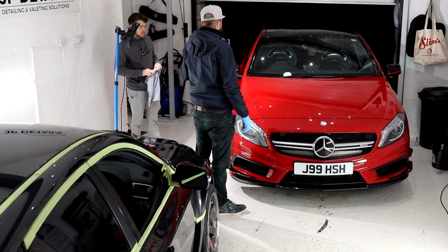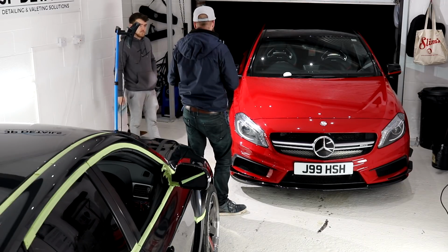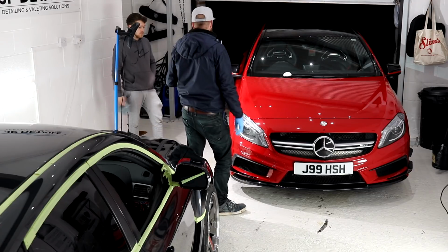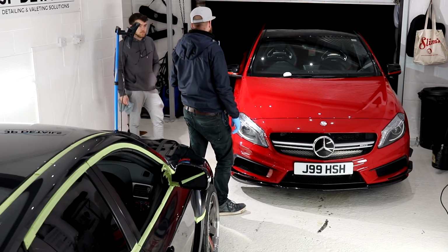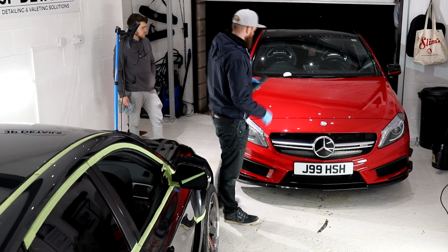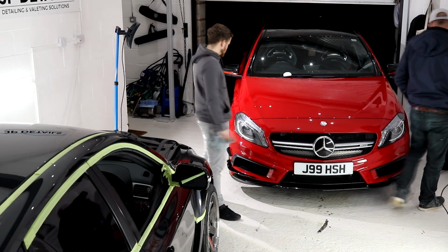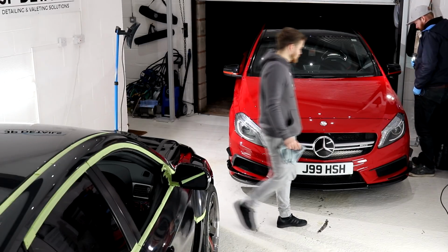Your gloss black trim, I'd treat with one of those cutting pads and fine polish. If that isn't doing it, step it up to the green. Exactly the same as paint, just bear in mind that they are a lot softer, and thinner paint as well. But a little microfiber cutting pad and some finishing polish should work wonders, should polish up pretty easily.